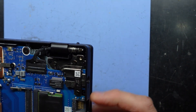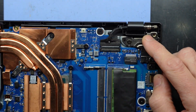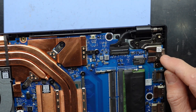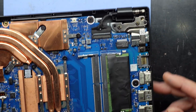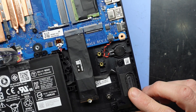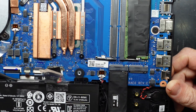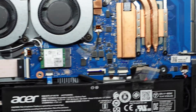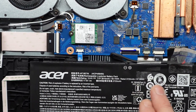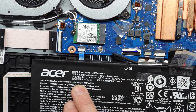The power lead is over here. If you damage the power port, the board will need to come out to deal with it, so repairability there is not as great. We also have a little CMOS battery which would be replaceable — probably won't need to replace it for about five to ten years. Here we have the battery — only a 57 watt-hour battery, or close to 58 watt-hour.